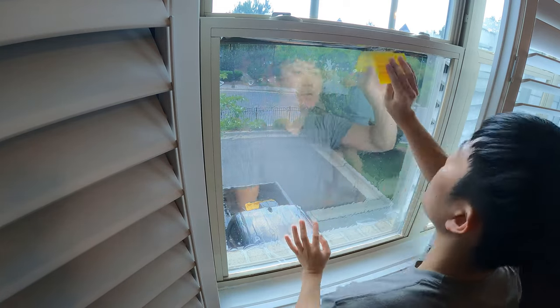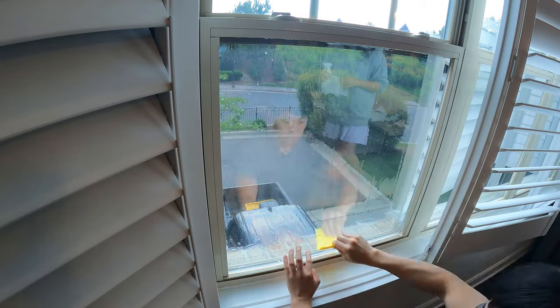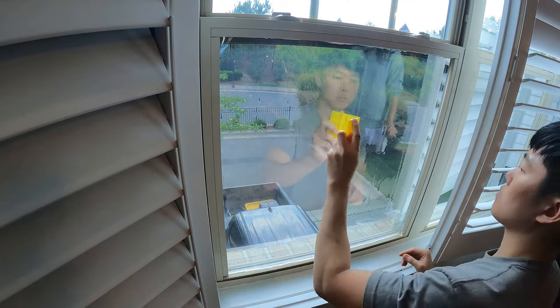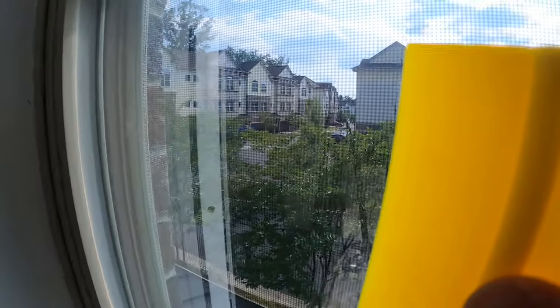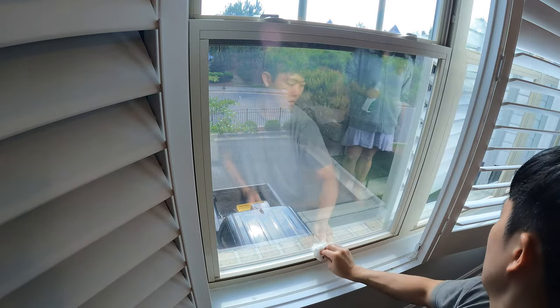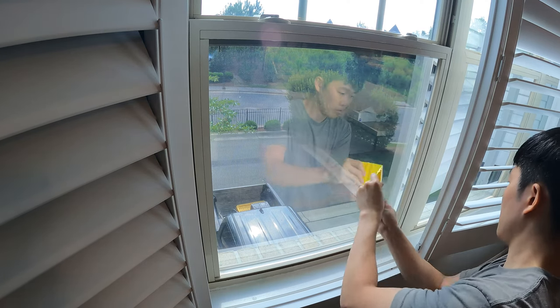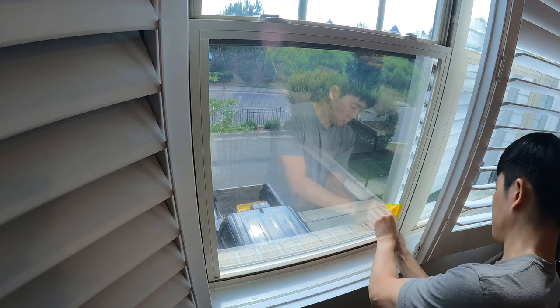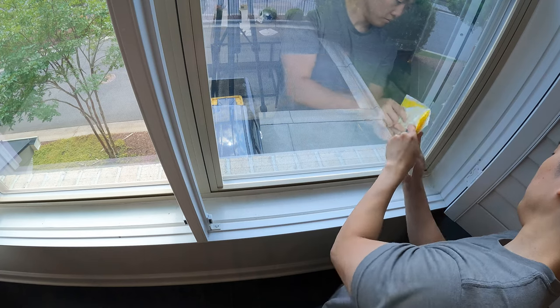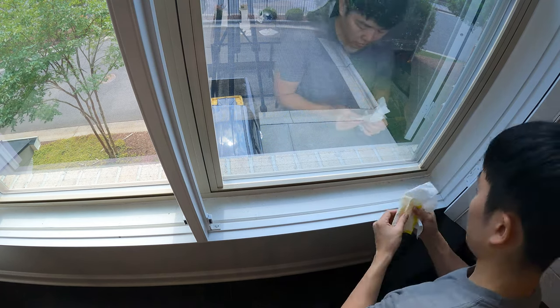If you've got it positioned right and it's aligned, you can use the plastic squeegee to remove the solution between the film and the glass, working from the middle out. You can also apply solution on the outside of the film to help the squeegee glide, but I found it kind of unnecessary. You have to press on the squeegee pretty hard to get all the liquid and bubbles out. Take a paper towel and soak up all of the excess solution around the edges as you work. If the edges or corners of the film roll back on you, don't freak out — it just means the adhesive isn't working because it's still too wet. Take a paper towel, wrap it around the squeegee, and give it another go. The paper towel will soak up the solution as it gets driven out from the edges, and the film should stay put.